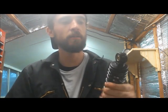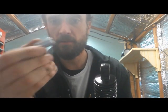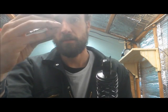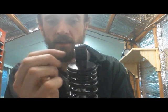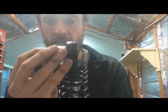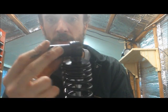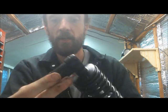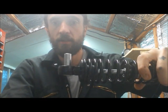Now sometimes you can usually just push them out almost with your finger, or with very little force. These are not vulcanized in, because obviously that would be pointless since they send you different sized ones, but they are an extremely tight fit. So all I'm going to do is take a small socket, this happens to be a 10mm socket, and that is fractionally smaller in diameter than the bush, so that whatever gets shoved through here isn't going to get stuck in the bush and leave me with the same problem. So that covers it and pushes in there, and then I'll use another socket on the other side, which will fit around the rubber bush and not mark the shock itself. The little one will push into the top, that whole arrangement goes in the vise, I'll wind it in and that'll slowly push it out.